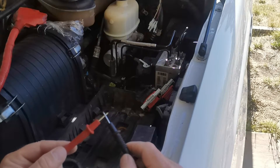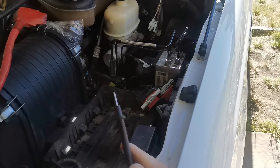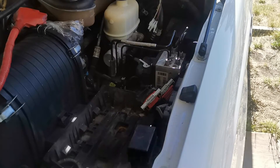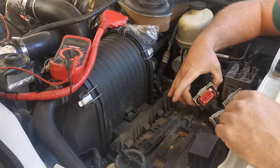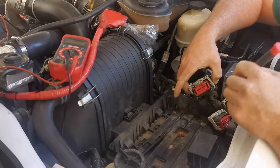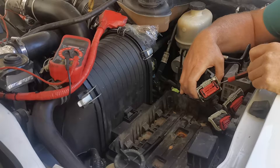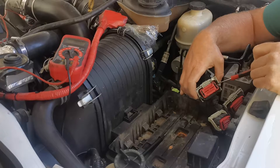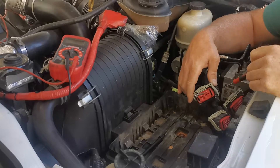I'm going to make sure this works — slip one wire into the connector over here and check the other wire down at the fan. It's the second connector and it's the second row, second pin from the right looking at the connector. I've got a screwdriver in it — it's blue. I thought it had a stripe but it actually doesn't. So: second connector, second row, second pin from the right on my 2006.